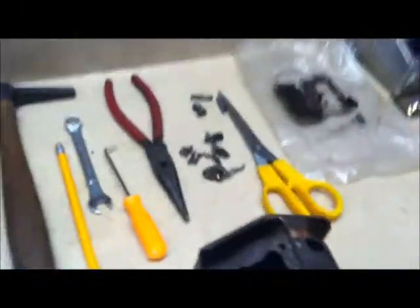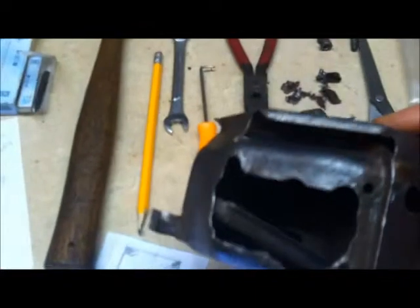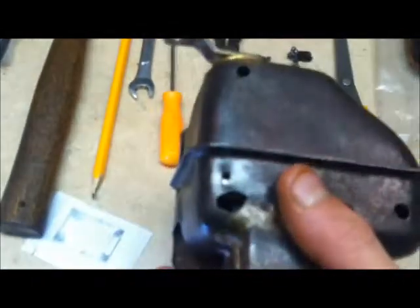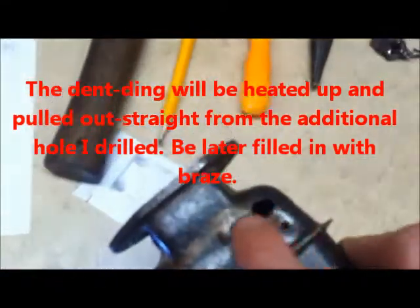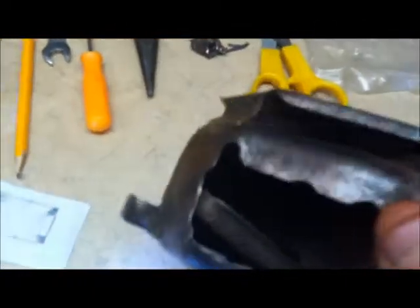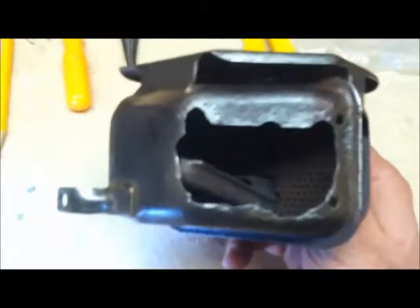I'm going real slow here. Pick up some speed once I start brazing. There are guys out there making pipe saws — this is probably an easy fix for them. I'm going real slow so I've got a chance to videotape it. Tomorrow I'll sandblast it. It's been a couple hours in the ultrasonic cleaner, I'll sandblast it, I can get inside now — hopefully I don't find any more holes or weak spots. I'll show you a couple ways to go about these holes. Here's that ding — I drilled a hole, I'll heat it up, straighten it out, and fill that in. Since I'm going to be brazing everything in, there'll be some grinding and sanding. Just trying to clean it up, make it solid, most importantly functional, and hopefully make it look something cool.